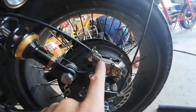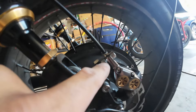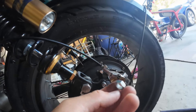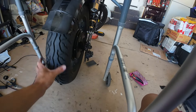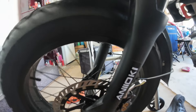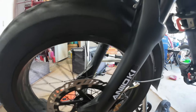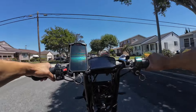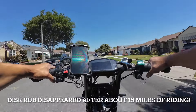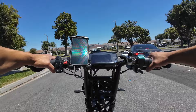We got the rear caliper to fit perfectly by using some bolts as spacers — a bolt and a lock washer, just using these oversized bolts. No rub, no sound, no scrapes. Earlier when I put my bike on the rack and centered the calipers there wasn't any disc rub, but now the disc rub is here when I'm riding. That is so weird.